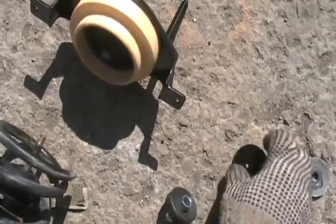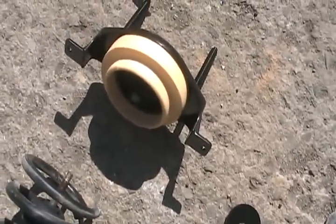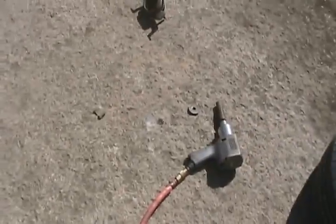Put this piece on next with the comb part facing downwards, then push the metal tube through as far as you can. Put the curved washer on next. Now you'll need two people — one person is going to have to hold it straight up and push down with all their weight so the shaft comes through the hole just a little bit. Just start the nut with your fingers, then whip the rest on with your big tool.